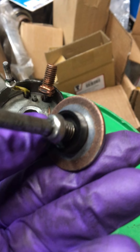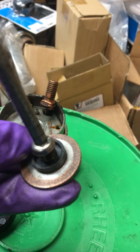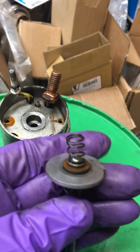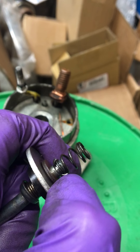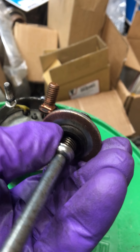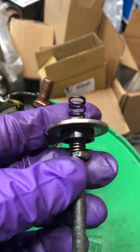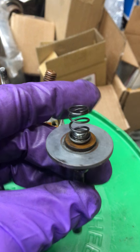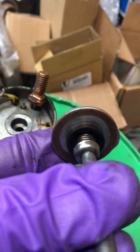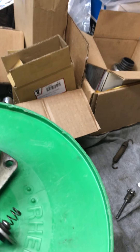This washer was heavily worn — a lot of copper showing and a lot of dirt on it. I just flipped it over. To flip it over, this spring just pops off, then there's that little keeper, and you just pull the washer down like that and the keeper comes right off. There's an insulator there and a plastic piece so you don't ground that out — if it touches this shaft it'll ground your battery positive straight to ground. That's why you have those insulators on there. If they're cracked, you're probably done. But anyway, that thing just comes up and connects those two studs and off the starter goes — really simple.